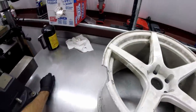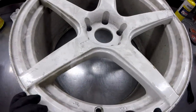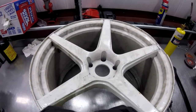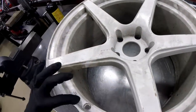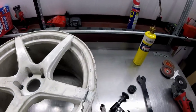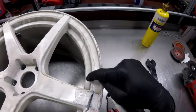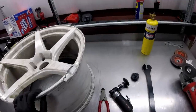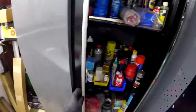Those are cheap to replace anyway. The next thing I really need to do is basically get all the paint off of this whole area and off of these pieces. The paint remover wheel - just get in here and get it as cleaned up as you can where you're going to weld. At least a centimeter around the crack line or anywhere you're going to weld is ideal - even bigger is even better. That's what I'm going to do next, then we'll go into the rebending and welding process. Put a mask on, this shit is gross.